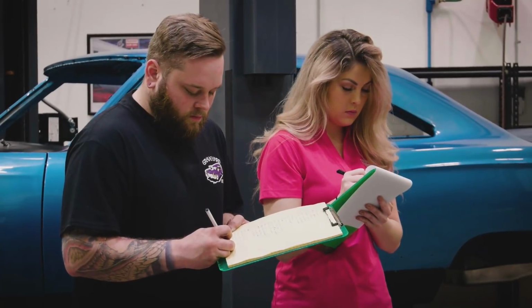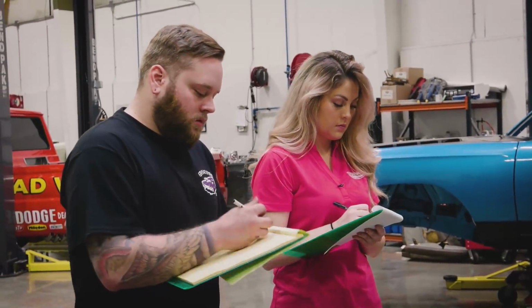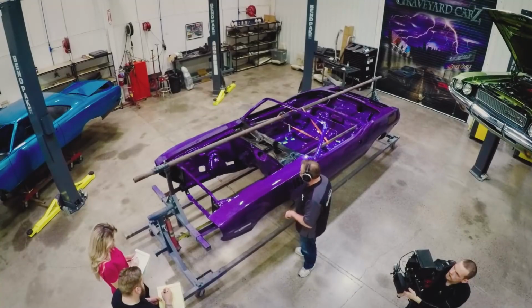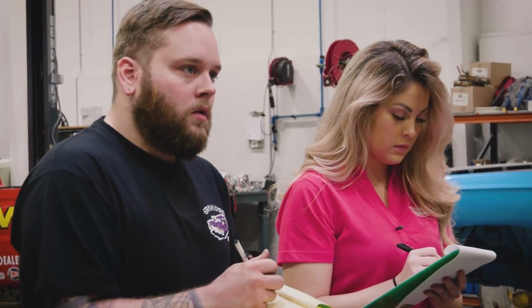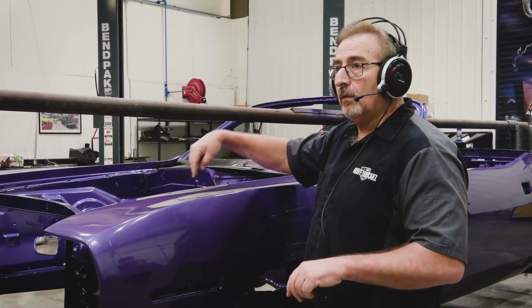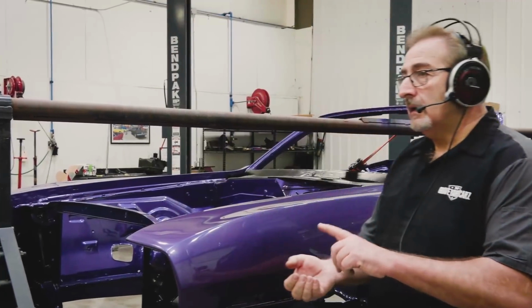Grill mounting hardware kit. Cowl screens, we're going to recondition those. We do want the new fender well block-off flaps. They go on that side and this side. They have little metal clips that hold them in place, but we want new ones of those. We want to order the fuel lines for it. So this is a 71, so it has the vapor return line that mounts up here and a 5/16 main fuel line that goes up to the engine. Fuel tank, sending unit, straps, J-bolts.